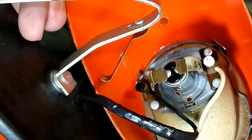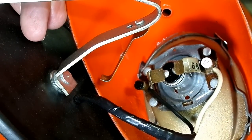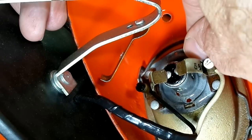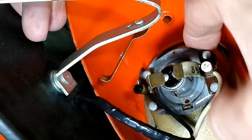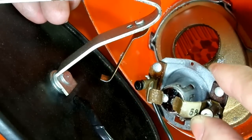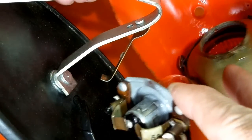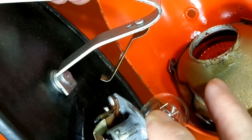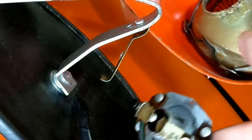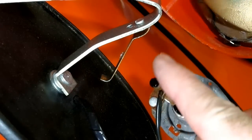What I've got to do is remove the holder from the housing, and what I'll do is I'll grab hold of the top. There's a little tongue and groove right here in the bottom. There's a little hole and groove right there on the bottom of the bulb holder, and there's a little pin right here that engages and just pushes in, and the spring holds it in place.